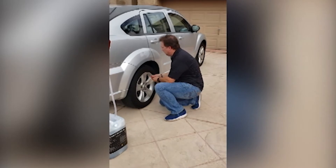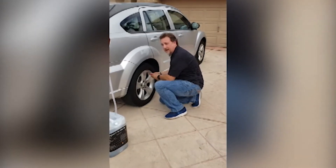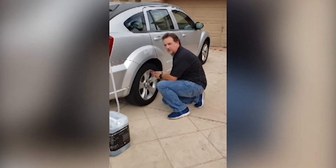Use a small tool to remove the core. Make sure that you don't lose it, because it pops out fast — there's air pressure behind it. So if you're not careful, it'll pop out across the room.